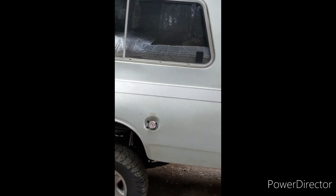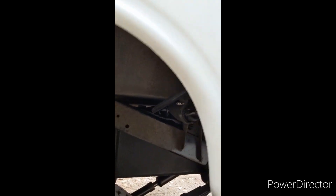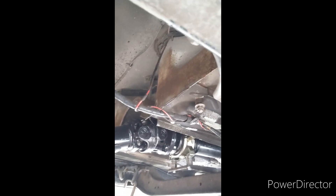I'll show you — we got the 20-gallon poly fuel tank in here. I got a flashlight. The custom driveline is a two-piece shortened unit, but we're running off the factory mount with a little spacer to get us perfectly in line with the tranny — nice and straight. Got a double cardan in there for the offset diff, and an inch and a quarter of up travel at ride height. There's the big poly tank, the overpriced filler hose, custom plumbing — a bunch of fittings that were overpriced, but quality costs money. They're all compression fittings.